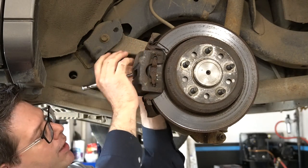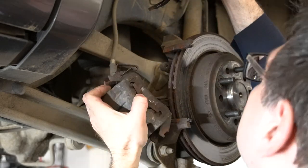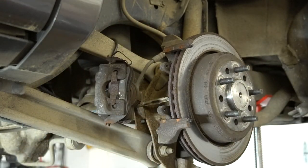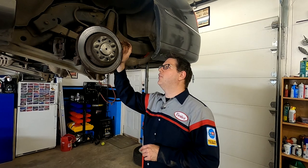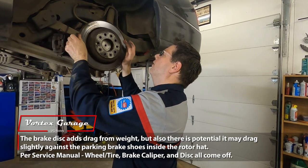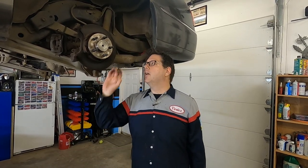The caliper bolts are 10 millimeter. All we're going to do is remove the caliper bolts, not the anchor. You also need to remove the brake disc. The book says to remove brake drag, you need to remove the caliper but also the disc — because as you turn it, you can feel and hear a little bit of pull, and it adds weight. We'll do both sides so our pinion measurement has no drag, exactly as the service manual calls for.